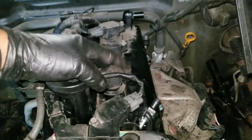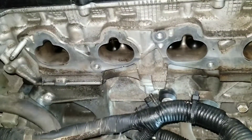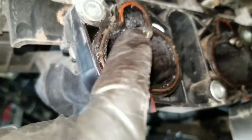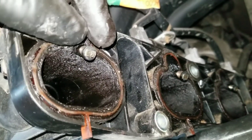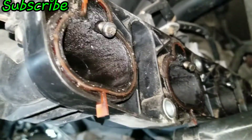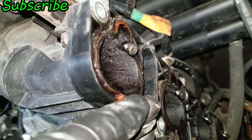Got the coils back on, all plugged up. While I'm at this stage, I figure I'll also change the intake manifold gaskets. You can see I cleaned the surface up — those are the original gaskets. I'll clean all this up, try not to touch the fuel injectors. Probably put some tape or a little piece of plastic with a rubber band over them just to prevent them from getting scratched or sprayed with any kind of cleaner. Then take these gaskets out — I got some new ones here.